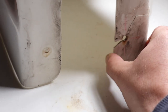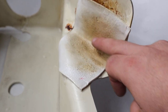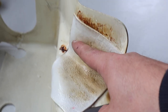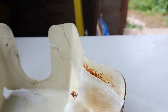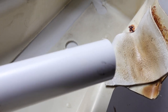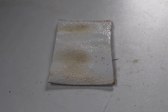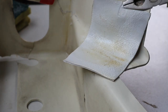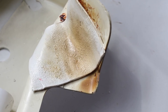The glue's all dry now — that is pretty solid, I'm happy with that. I've also stuck a patch on the inside there just to reinforce this section, as this was the worst section. It was cracked along here and I think there was also a crack just going up there as well. It's not perfect but it does the job. All I used for this patch was a bit of PVC plumber's pipe — cut a bit off roughly the size I needed, cut a line down there, heated it up, flattened it out, let it go cool, and then once it was flat I just reheated it up until it went all soft and floppy. I put it onto the affected area and shaped it to the shape it needed to be — it's on there pretty well, there's no chance of that coming off.